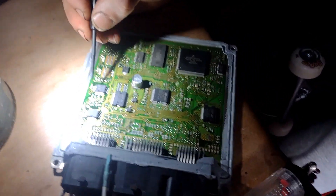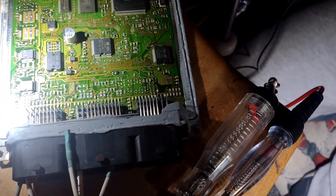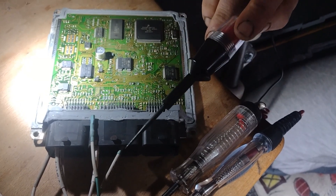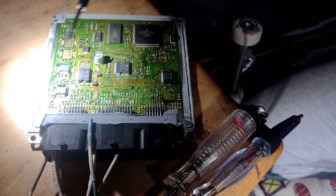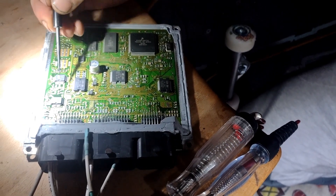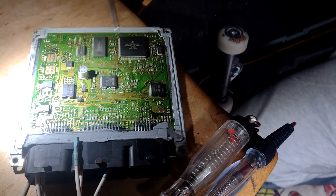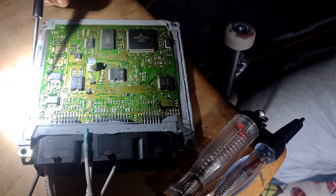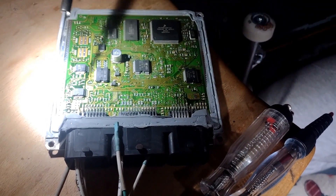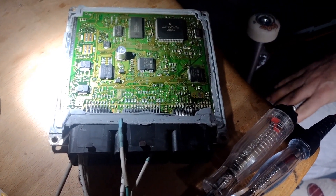The main thing I wanted to show is: if it's getting triggered but we don't get these switching on, it's important that we've got all our powers. That's just to show that one 12 volt supply - if there's one missing and it goes to a five volt regulator inside, then these don't work. So if there's no spark, it could be that the processor sends the signal out fine, but with one power missing - maybe just one fuse gone - we get power to this but these won't work. So before going too far into the ECU, check all the powers and grounds going to the ECU.